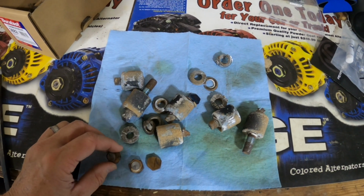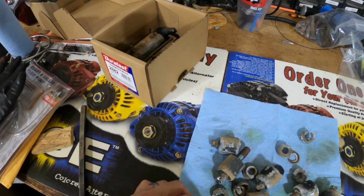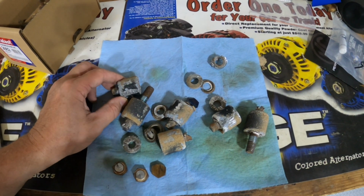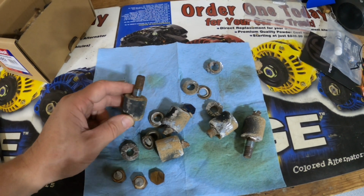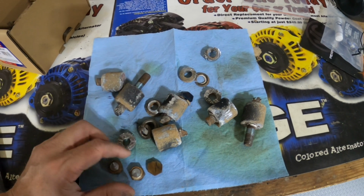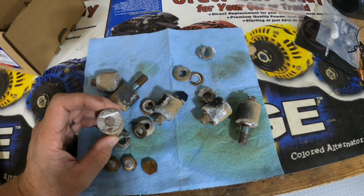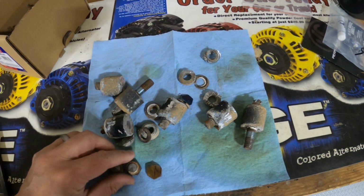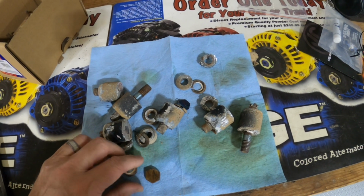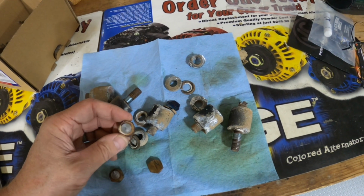So here's what prompted the whole need for this project. I needed to change out the transmission mount there, and the Jeep has a 4-inch lift and already had these 1.5-inch spacers dropping the skid plate down. But Lord knows how long they've been on there, and what happened was when I took them off, 2 of the bolts came off, 1 was already missing, and then the other 3, the heads just snapped off the bolts.